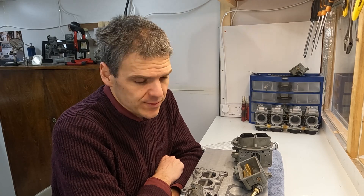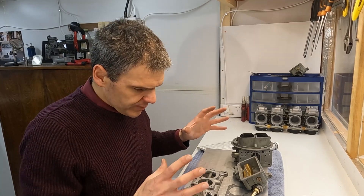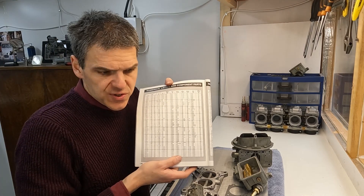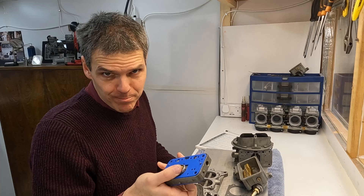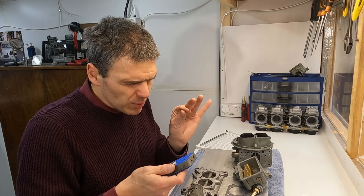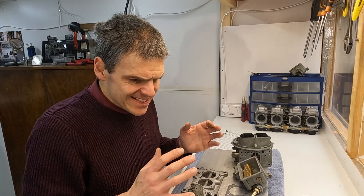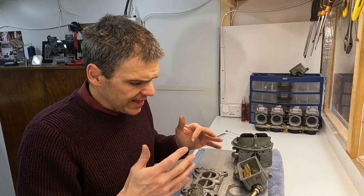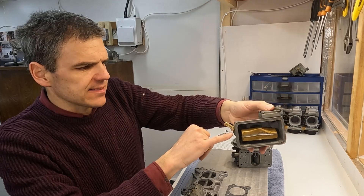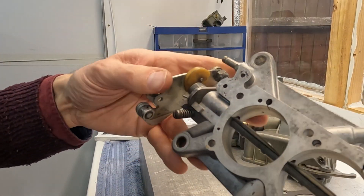It's been several days later and we're starting to go places with this build — we're in a good intermediate position to do the final assembly. A couple of important things I always mention: checking the manual for jets and the right power valve. In this case it's 73 main jets and a 55 power valve — it uses a 50, but if you go 0.5 out, it'll work absolutely fine. That's an important stage to make sure you're putting the right things in. I've also checked the float — that's all working great.